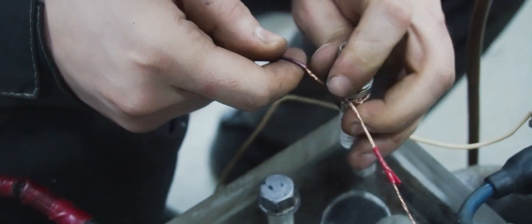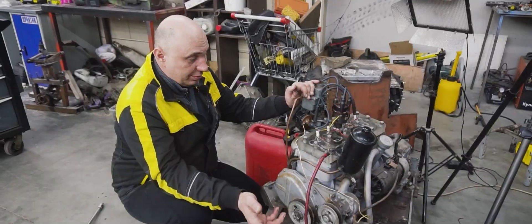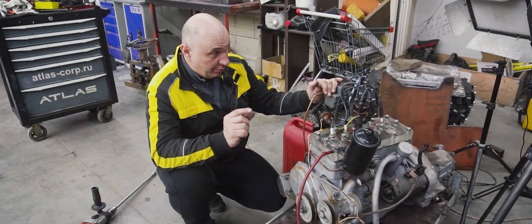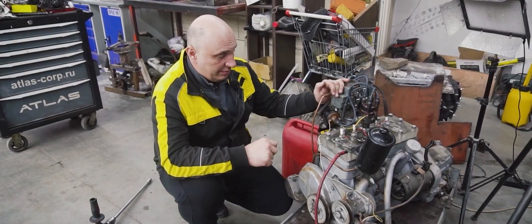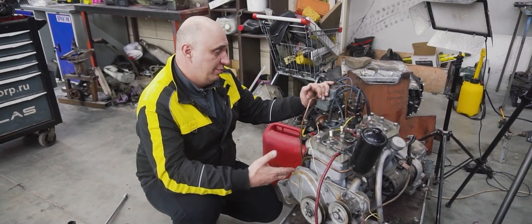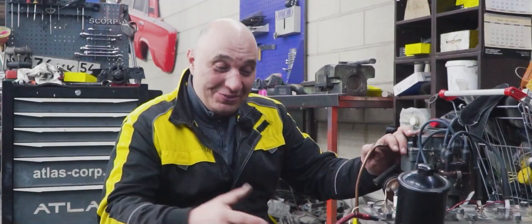So we fitted the distributor. As for the plugs, we tied a ground wire to them, since plexiglass obviously can't conduct electricity. The stock plugs for this motor have a short threaded section, so we decided to go with longer-threaded ones, given that plexiglass is less durable than iron — we could rip the thread out otherwise. The plugs are installed. They're used, but they'll ignite any mixture no matter how rich or lean it may be. Let's fire it up — I am super curious to have a look.